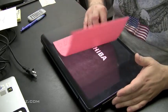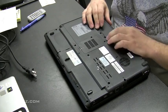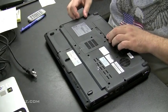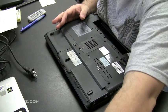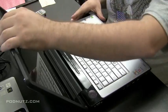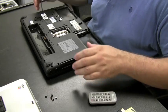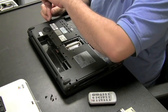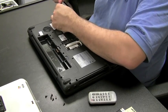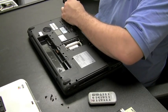What do you do if you have a water damaged laptop? The first thing I do is make sure I pull out the battery and I don't even try to power the laptop on. Pull the battery out, don't hit the power button, and get ready to take the whole thing apart, because we're going to inspect the motherboard and see if there's any moisture or liquid still on it. If you suspect there's any liquid in the motherboard at all, do not power the computer on.